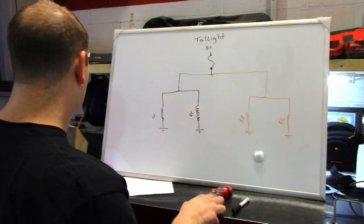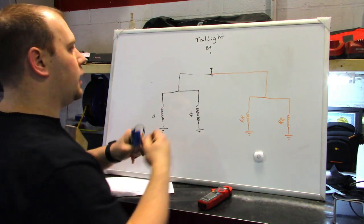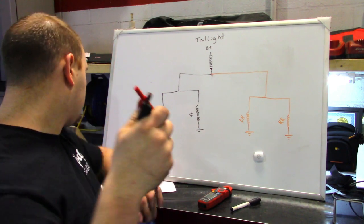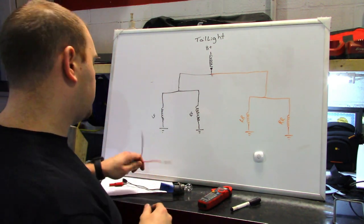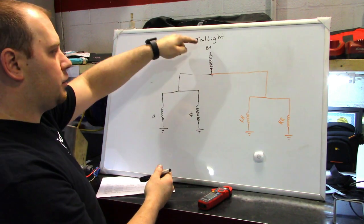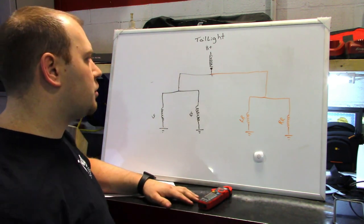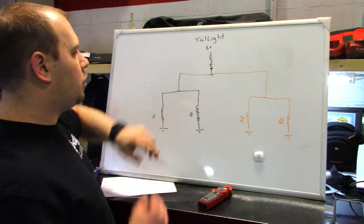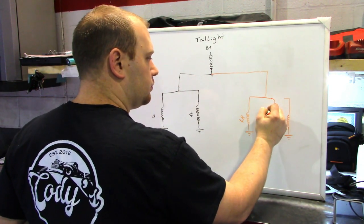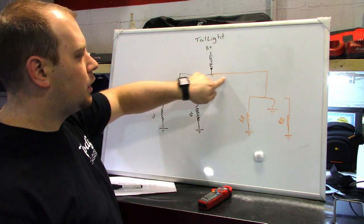So to avoid going through a hundred fuses, I'm going to remove the blown fuse and instead put a light bulb in its place — just a 2 amp light bulb with banana ends on it. I use front probes to go right into the fuse slot. So instead of having as many amps as the battery will put out going through the circuit until the fuse pops, I now have battery positive coming down through a bulb. If the circuit is shorted to ground, current flows through my light bulb and out to ground.